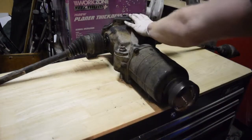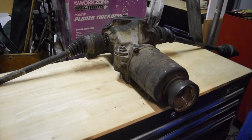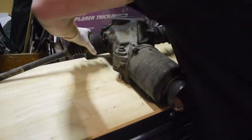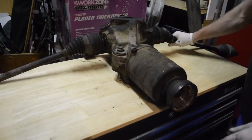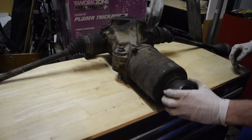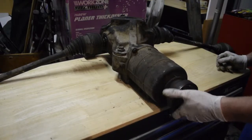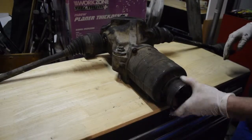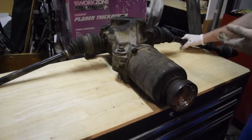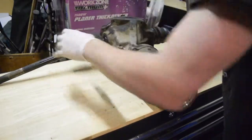I've got the diff on and I've got the drive shafts just sitting in there — I don't really want to put them fully in since I'd have to take them back out. They do rotate as long as I don't pull them out too far. But when I rotate the input from the tail shaft — or prop shaft, depending on what you want to call it — there's nothing; no movement of either drive shaft in either direction. But if I turn one of the drive shafts, then there's movement of the other one, so there is definitely a diff in there, definitely connected and working, but yeah, the input just doesn't want to turn through.